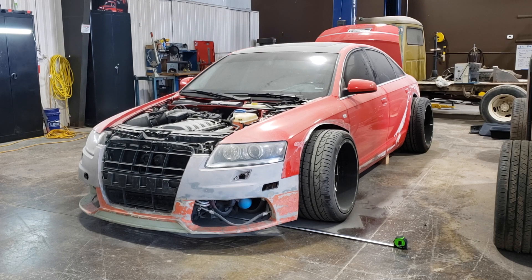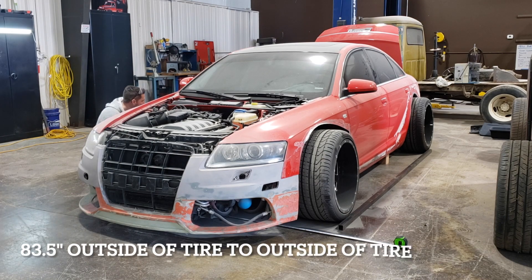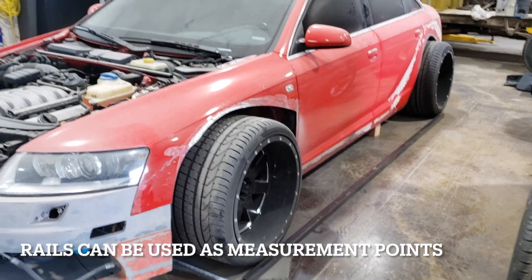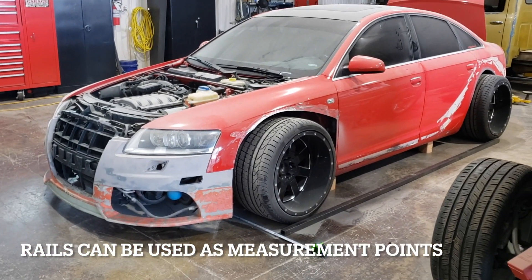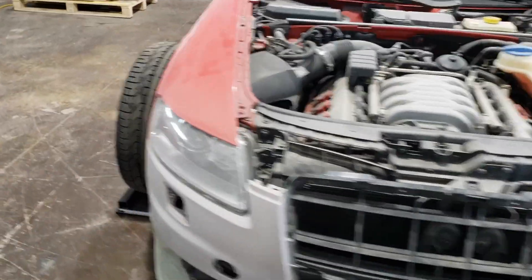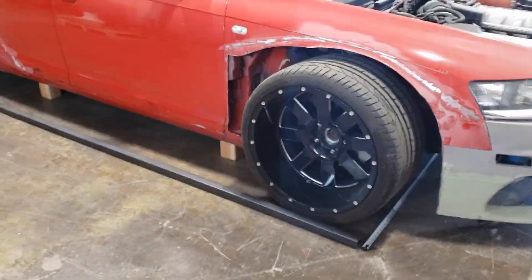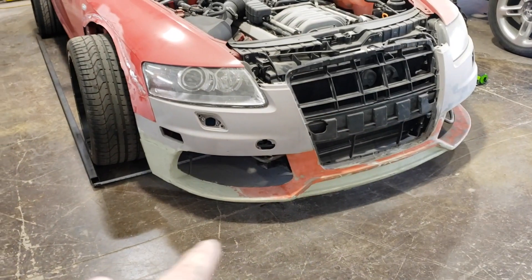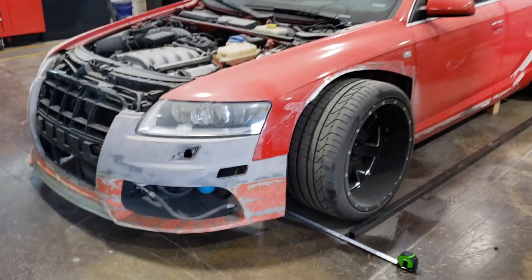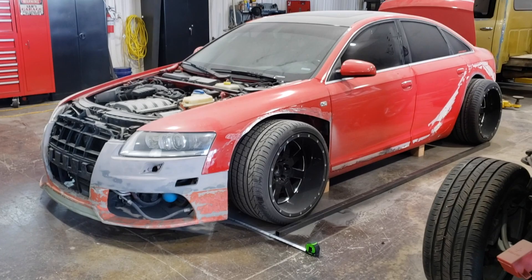I'd been asked a bunch of times how wide the car actually is but had never checked. So today I laid a couple of bars against the tires and stretched a tape measure from the inside of one bar to the inside of the other. I laid two steel rails on the floor — you could bolt them down, but I can just bump them up against the tire. Right now I'm just looking for the track width on the outside so I can build the front lip and splitter. It looks like we're right around 87 inches, so I'll go ahead and get the board cut and laid on the floor to start mapping out the shape.